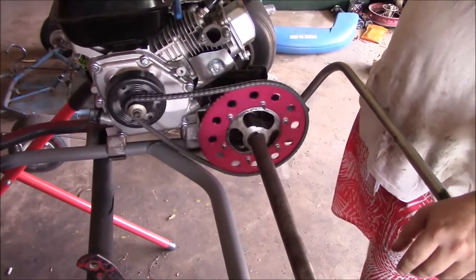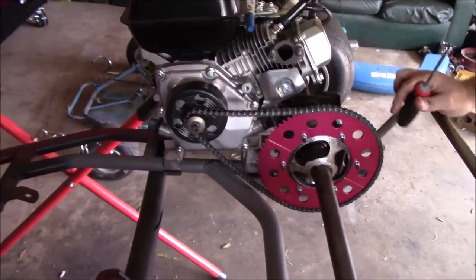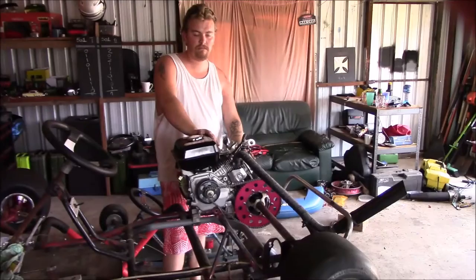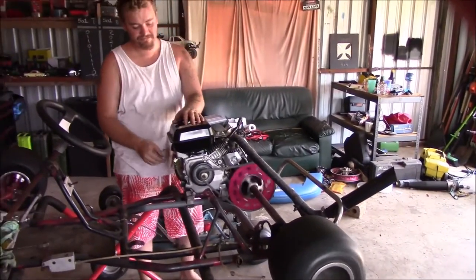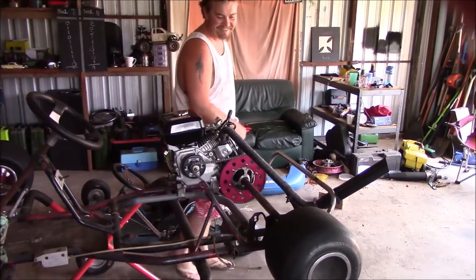Because I've moved the motor back the chain still looks a little sloppy, but that's not a bad thing — most chains like motorbike chains should have a loose spot and a tight spot because sprockets aren't always perfectly round. If you've tightened the engine down and the rear wheels don't move easily with just a little flick, your chain is way too tight. You should just be able to flick it and have the chain move easily. To tighten, loosen the bolts at the bottom and slide the motor forward. It's alive!